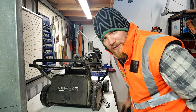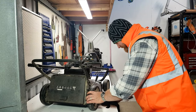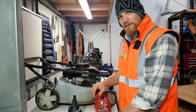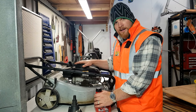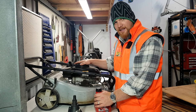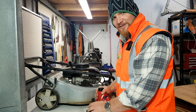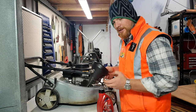We've made a little bit of a mess - nothing the rag can't handle. Now it's time to get fresh oil back into the unit. Had a quick look online - these take about 600 millilitres of oil, so engine oil capacity is about 600 mils. Just check with your manufacturer's guidelines for the lubricant it uses and the amount it needs. I've got my 4-stroke oil here, SAE 30, and my funnel - let's pop it in.